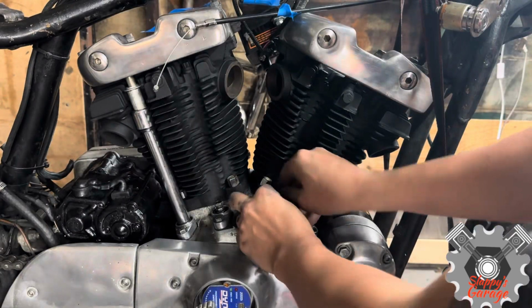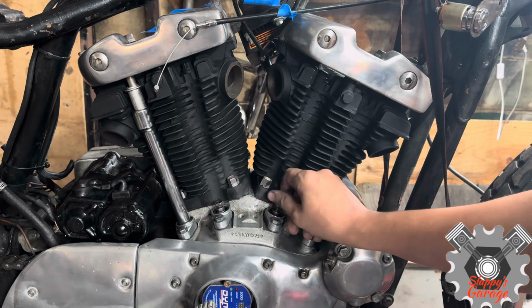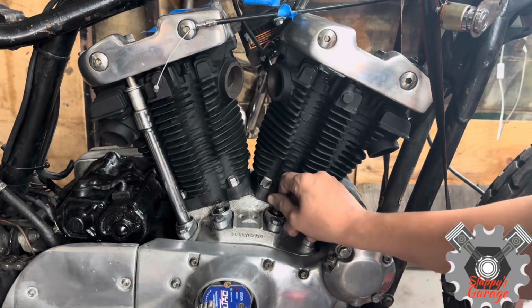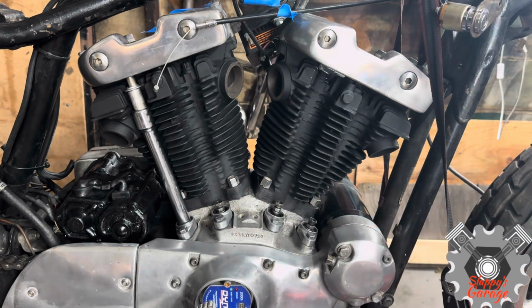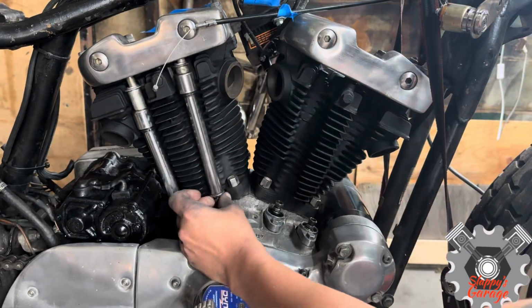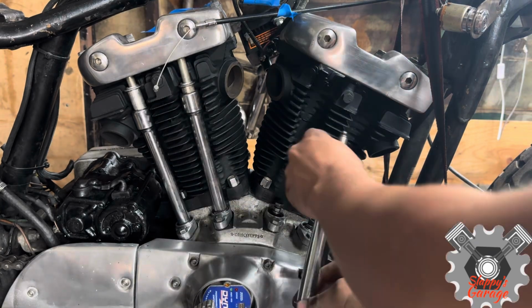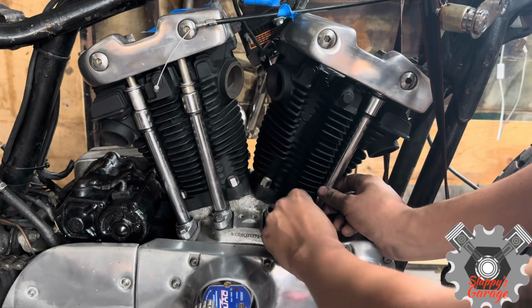Now, with the push rods, I pulled the adjusters all the way out to tape over and have it nice and flush from when I was painting it. So I'm reinstalling the adjusters all the way down so you have a nice amount of room for the push rod. You might have to rock the back wheel to get the push rods to release and get less tension so you can slide them in. But they slide right in, and you put the adjuster back out so they hold in place. And then you continue to adjust later on when you're at top dead center. And we'll go through that in the next video.